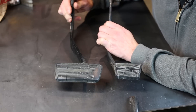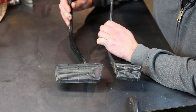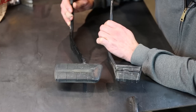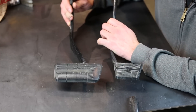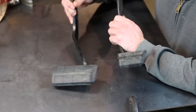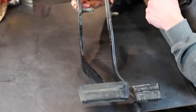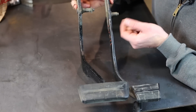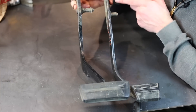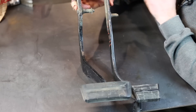The first thing I'm going to do is get the brake pedal set up. The one on the left is the brake pedal that came with the truck — it's obviously from an automatic because it has the really wide pedal. I bought this skinny brake pedal from a junkyard. It doesn't fit for a couple of reasons: the profile is different, and the part where the rod to the master cylinder connects is not the same — they're different lengths. Also, the connection point is closer to the pivot point on one versus the other.